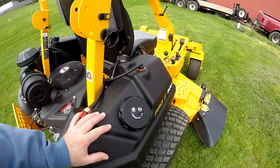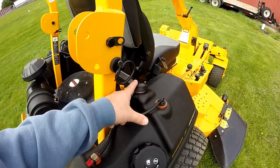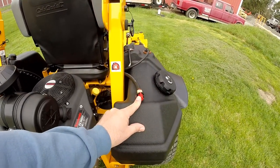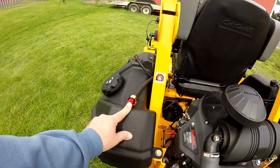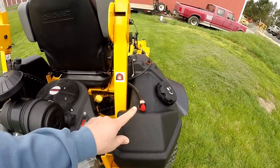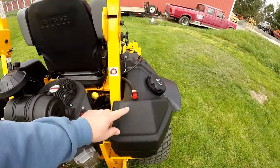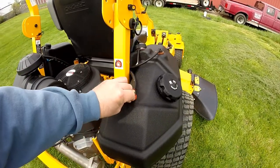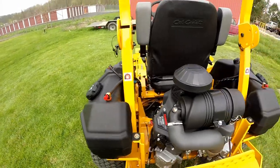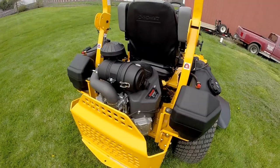At the back of the machine we have the two twin tanks. Right on top of each tank is the sending unit for the fuel gauge and some emission hoses. You also have a fuel shutoff for each tank on top of the tanks. Make sure that you're running one tank or the other — if you're running two at the same time and start to run out of fuel, the engine will suck air and start to shut off. So only run one tank at a time by moving the other to off. Each tank holds seven and a half gallons.